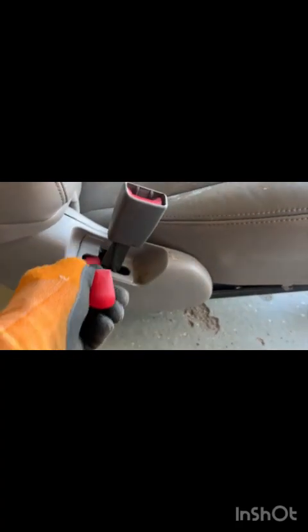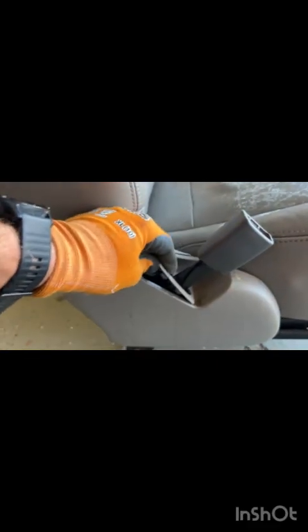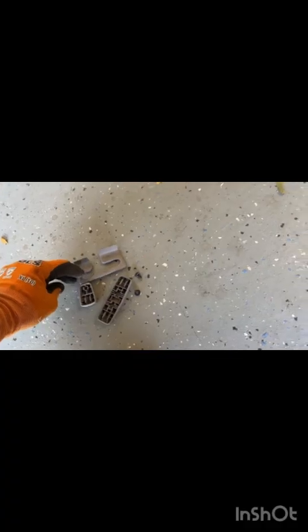With those 2 screws out, you want to take off these pieces of side trim and kind of just stick your finger in there and pull away from the seat out towards you where the seat belt is, and then carefully pull up. It's got these little toenails here that hook on the edge. And pop that guy totally out of the way. Again, set it with all your other pile of parts in a safe location.